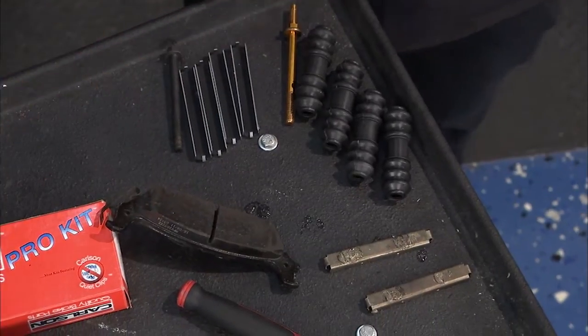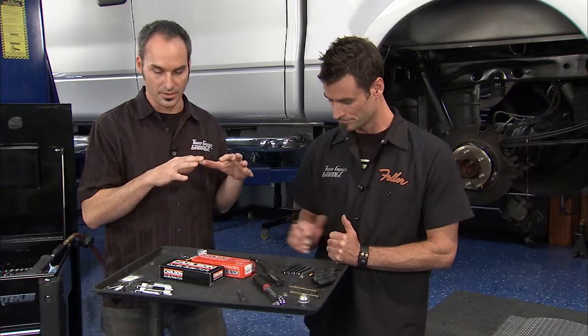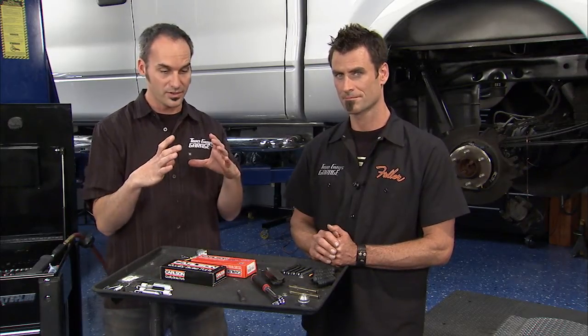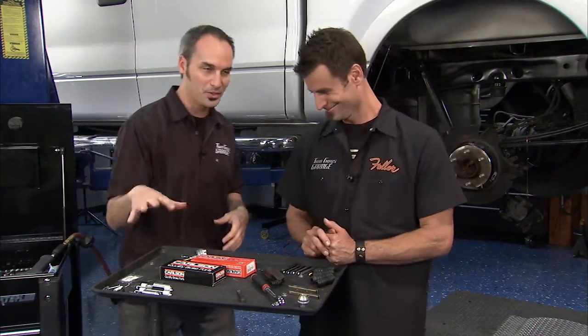An easy way to take a really nice brake job — you throw 10 or 20 bucks, you put all new hardware on it, everything slides properly, your pads retract so you don't wear out. Great way to knock those high-frequency noises down. Now we're going to redo the brake hardware for the parking brake — that's something everybody overlooks. A lot of times on an automatic car it never gets used, so that stuff just sits there, corrodes, and maybe it gets used once and then it doesn't retract properly and you're dragging your parking brake around. Or you overuse it by pulling it really hard around a corner. So we're going to do the parking brake as well.